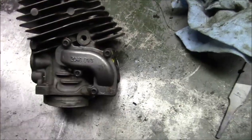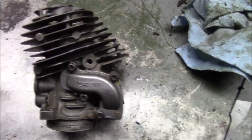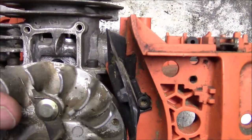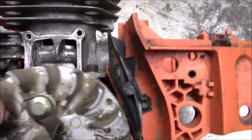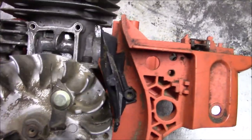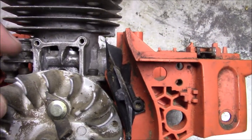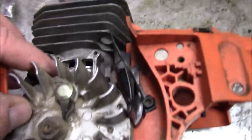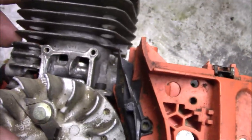Well, the reason why you see a lot of these guys adjusting the top of the transfer, the roof of the transfer, is because of this. This is exaggerated. But look what happens here when you lower the cylinder. Basically what's happening now is you're exposing the piston at bottom dead center, right? When that thing is supposed to be open, if you've lowered your cylinder enough, what's happened is you have that square edge defined by the crown of the piston itself. So what do you do? You raise the roof of the transfer to mitigate the lost cross-sectional area.